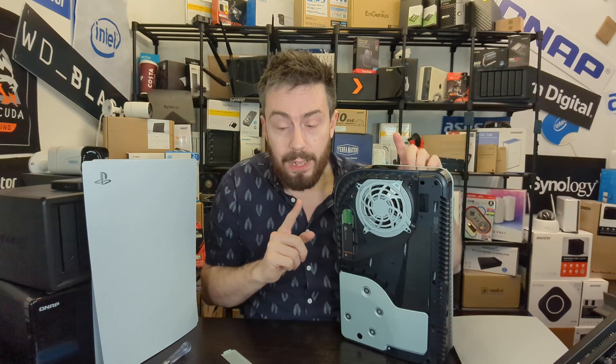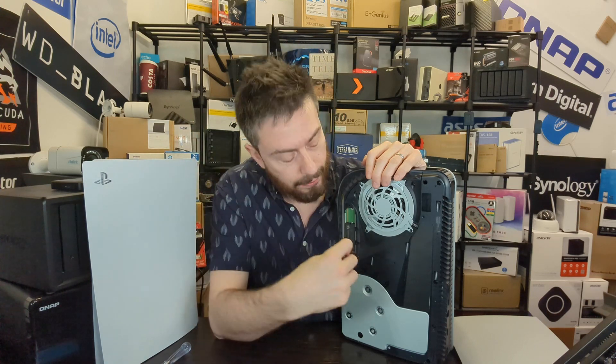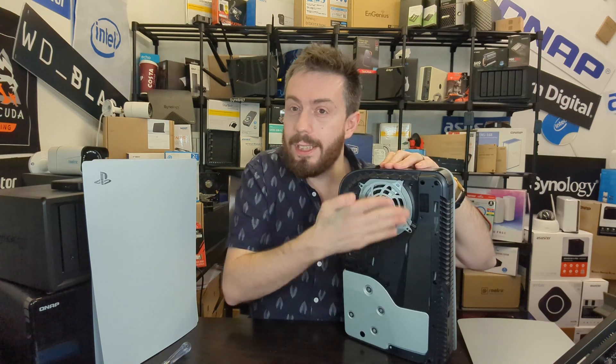SSDs perform at their best and are most durable when you keep the SSD beneath 50°C — that's why you need a heat sink. This video is about: once you install it in there and put this thing on top of it. Anyone that's worked in storage for a while knows that covering an SSD — particularly with its heat sink in a closed environment — is generally a no-no. Sony say because this system takes advantage of negative pressure, where air is pulled in the front and shot out the back, it's okay.